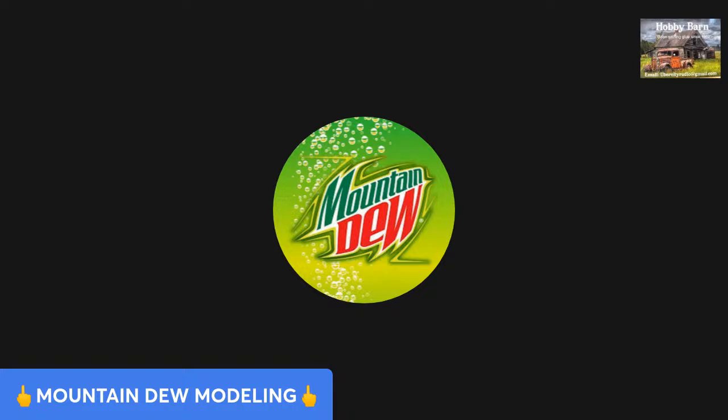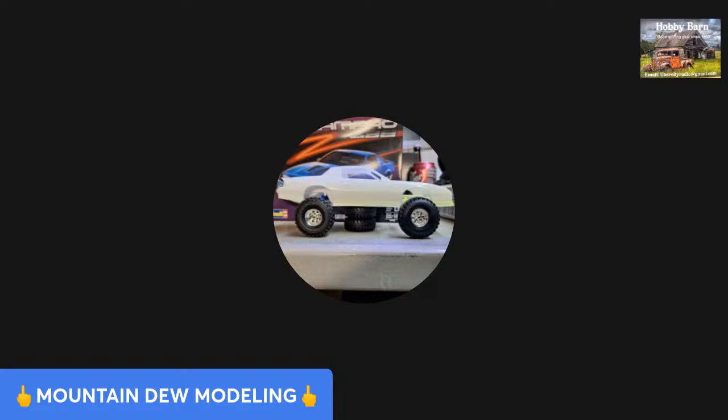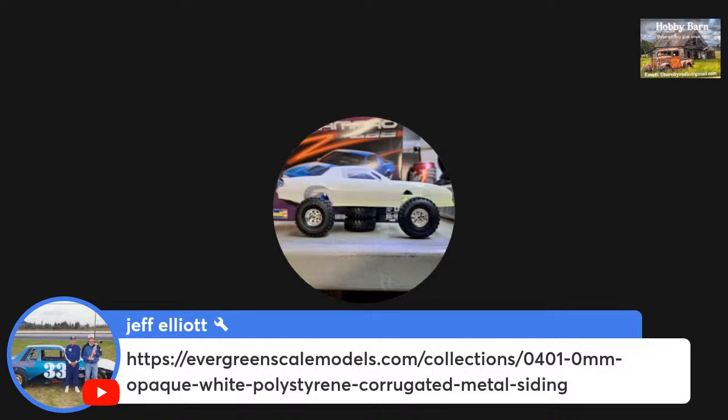I mean, that's one of the major reasons why I'm leery of opening the doors on this '99 Silverado street machine, because the front doors, there's not a lot of room on the back side of the front fenders, right there in front of the doors where the hinges would be. Like I said, there's no A-pillar in it to put a hinge. Plus, the A-pillar that's molded in is part of the door. I'd have to build an interior A-pillar from scratch for it.